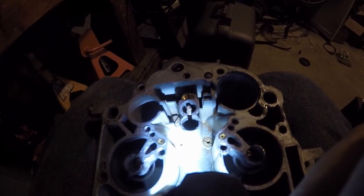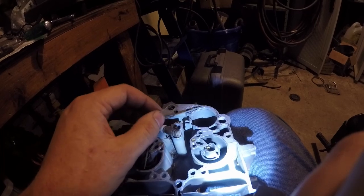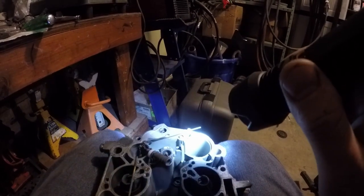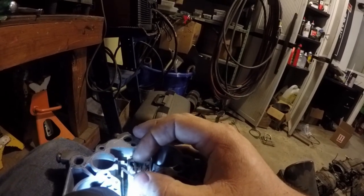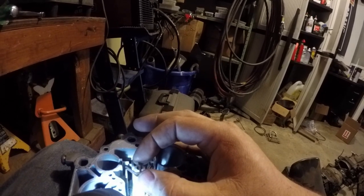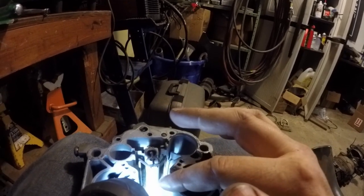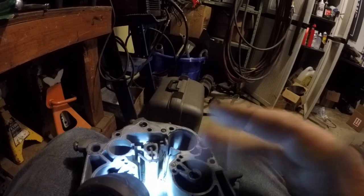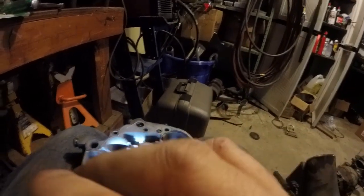And just the hole — and then these are your primary metering rods. As you can see, they get skinnier as they go down, so the deeper this thing goes into the jet, the more it blocks the hole. This fits in here like that, and there's a spring in there that keeps it lifted up. But on the bottom of this hole there's a port to vacuum, so at idle the vacuum will pull this down so not much fuel comes out. Under heavier throttle there'll be less vacuum and the spring will make these rise up and give it more fuel — that's how the primary metering circuit works.